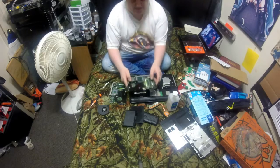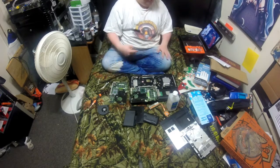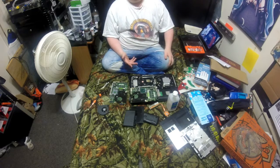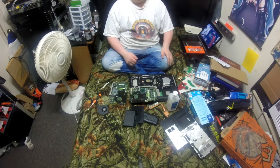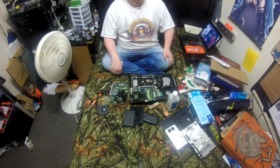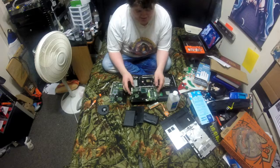One of the main reasons I stopped caring for the PGA type chips, which are pin grid array, is every time I went to do thermal paste reapplication because thermal paste goes bad or something, it would always rip the CPU out of the socket. And then getting it off the heatsink is a massive pain in the ass.